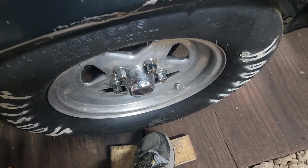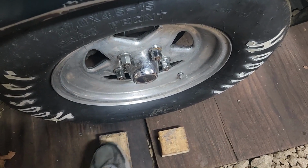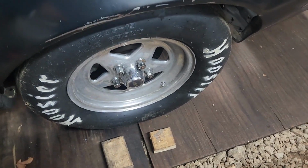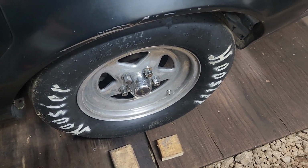But you can still deep stage enough that you're farther into the beams, but you're not so far that you're turning this light out, and that's going to help your reaction time also. It's kind of hard to do that on a Pro Tree. The reason why is sometimes when you light both of them beams, that light goes off.